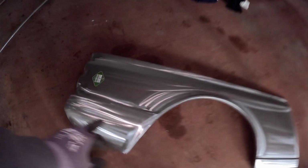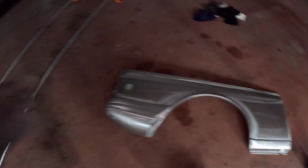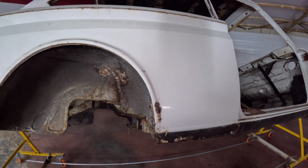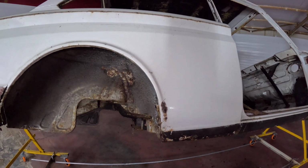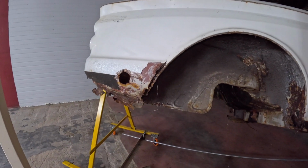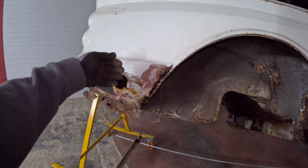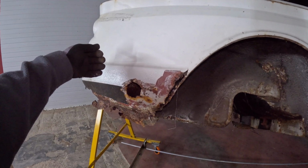You don't have to be grinding off welds here where it's weak, and most of the distortion that historically I've seen on panels being replaced is actually on grinding back of the welds. It's not actually in the welding itself. Everybody focuses on, you know, let's take care, let's cool the panel down, let's get an air hose, let's put some putty behind it, and they'll take a fantastic amount of time going round about, but yet the welds will still be protruding forward. Flap discs, when it comes to actually generating heat, putting them in the panel, they're very uneven.